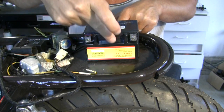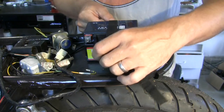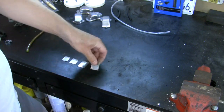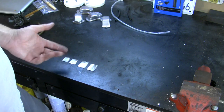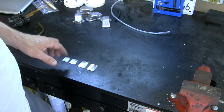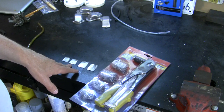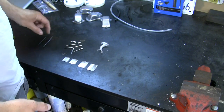I need some kind of a strap over the top to hold it down, so I really need four little brackets — here and here — and then I found this little strap I can fashion to hold it down. I found some scrap 16 or 18 gauge sheet metal — pretty thin but rigid enough. I cut out some almost rectangular shapes; I need to true these up a little bit but this is purely functional so I don't care how aesthetically pleasing they look. I just need little retainer brackets and the intention is to pop rivet these into the electrics tray. These are 3.2 millimeter rivets.